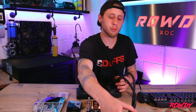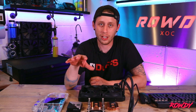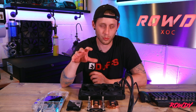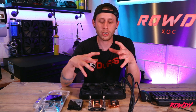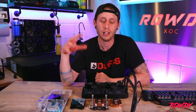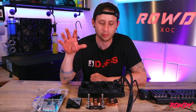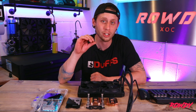The other drawbacks are from a performance level. What you get out of the box is all you will ever be able to get. You can put more powerful fans on there, but in all honesty, in the grand scheme of things, major airflow for a radiator doesn't really help you as far as giving you major gains in performance. The biggest way to upgrade your performance is bigger radiators, maximizing the efficiency of a radiator, and upgrading your pump to get better flow.